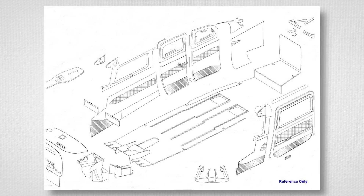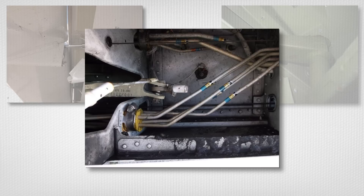Remove all interior components to expose the aircraft structure. Remove the flight controls, wings, rudder, elevators, horizontal and vertical stabilizers to facilitate better cleaning of individual structural sub-assemblies. Consult the aircraft maintenance and service manual for instructions on disassembly of the airframe. You will then want to remove all sub-components, including but not limited to actuators, bell cranks, and push rods.